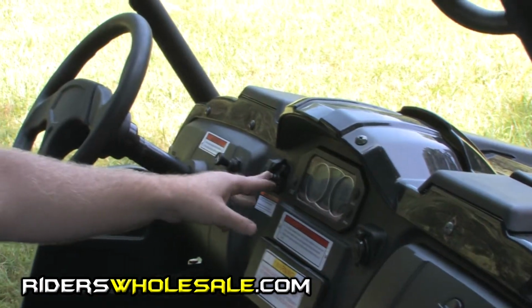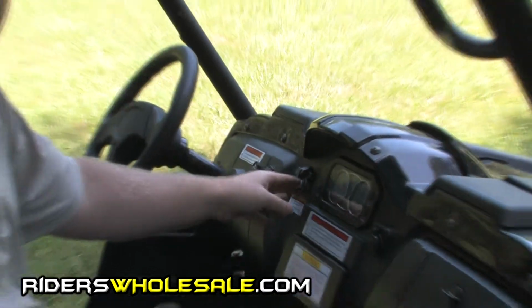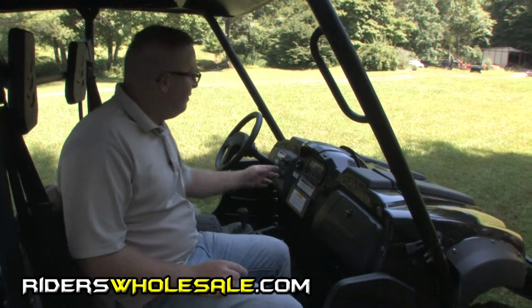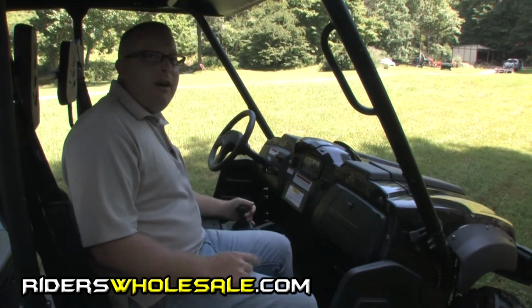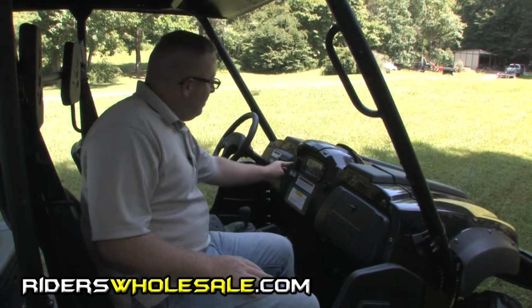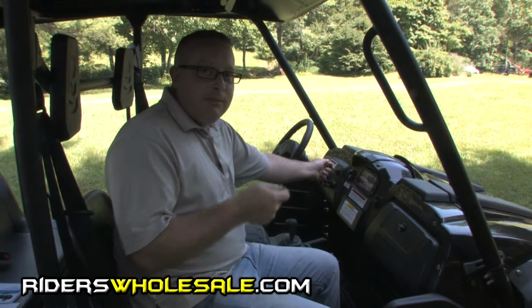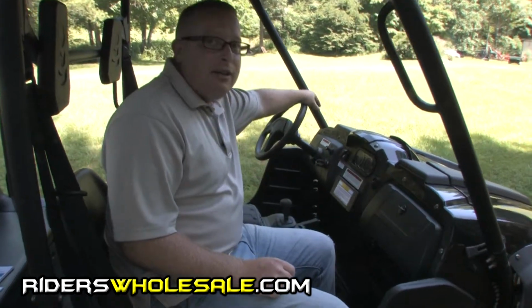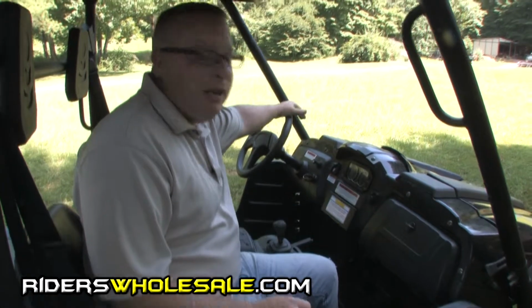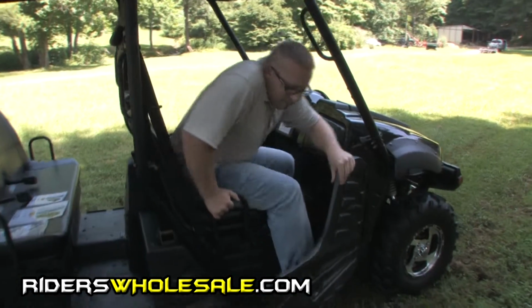Over here, it's a push button 2- and 4-wheel drive machine. You just push it in for 4-wheel drive, push it out for 2-wheel drive. If you get in a real nasty situation, you got your differential lock here that locks them all in too. And on them cold mornings, you got a choke. You just pull it out, turn her over, she fires right up. Then on the other side there, you got your light switch. High beam, low beams. That's all they are to the driver's compartment on this.